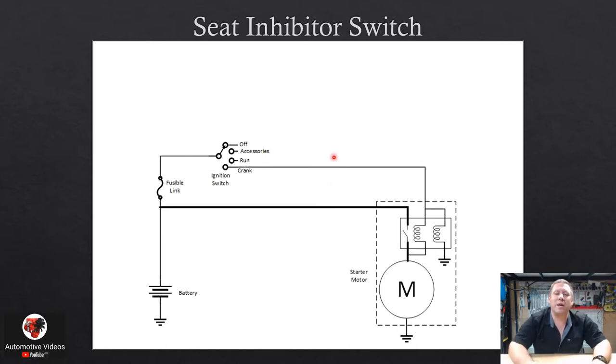In our previous basic circuit, we simply add a switch into the circuit. This seat switch means power comes up to the switch and when the driver turns the ignition key, current flows down to it but won't go anywhere until the driver sits on the seat. As soon as the driver sits down, the contact is made, current flows to the solenoid's ignition switch terminal, the solenoid activates, power flows to the starter motor, and it works the same way as the basic circuit.